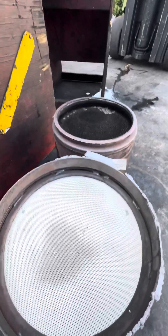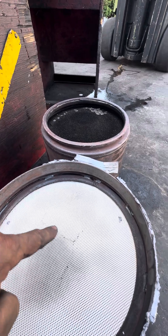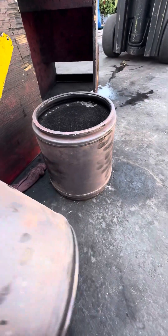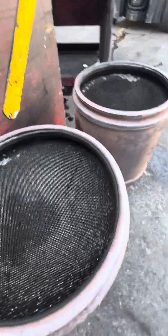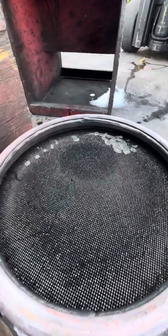These are the filters, the DPF. This is the backside. If you can see this, something's definitely coming through. This means it's cracked — it is compromised. The DPFs are compromised completely. Let me flip this thing over just a little bit and you can see some of the cracks. The soot is kind of hiding it.